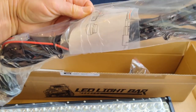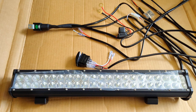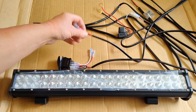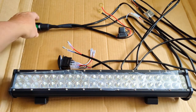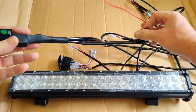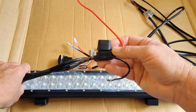I can see the directions in here. I'll take everything else apart and start working on it. A quick look over the directions — seems that it's pretty straightforward. The main things I wanted to see: all these connections are made up to the point where they connect to the back of the switch. And here is your 40-amp relay. What I really wanted to know was how many amps it drew, so I opened this up and it's got a 15-amp fuse in there.